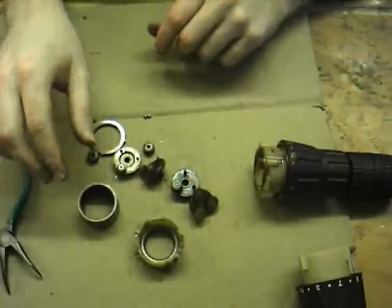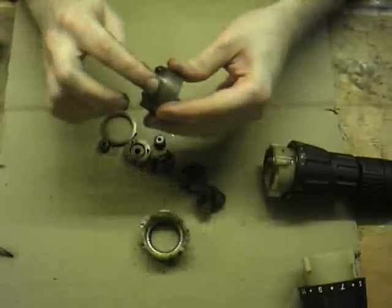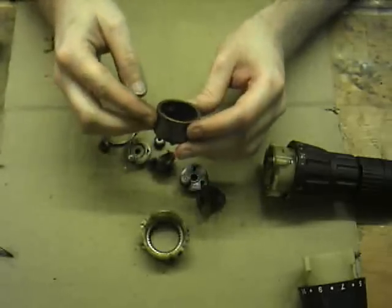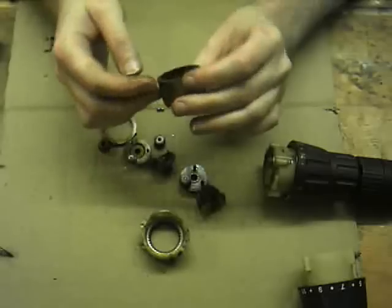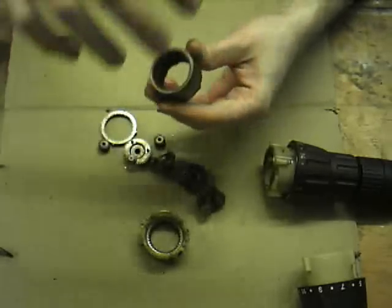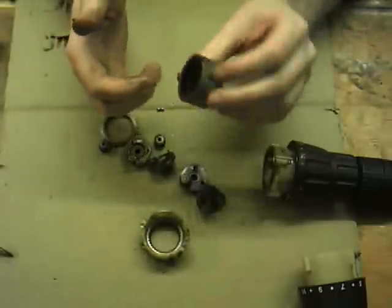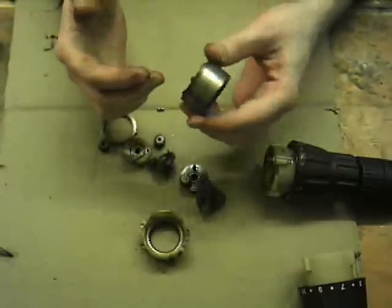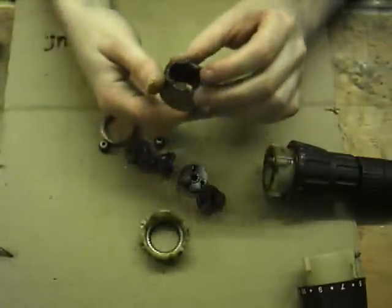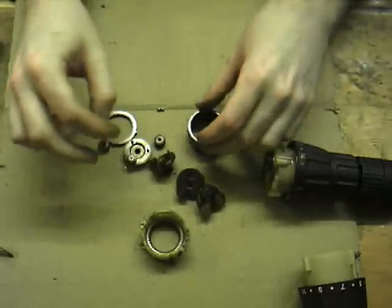Now, what I saw them do on the Pi-1 blog was, because you've got these teeth here, you've got something that you can secure the annular gear to. And what I'm planning to do is, his one was completely encapsulated in an aluminium block with a hole milled out, and this is steel, this is quite nice, it's going to be very sturdy, so all you really need, I think, is to make a recess in a plate. I'm going to go for making a recess in a plate with some holes to accommodate the studs here that will stop it from turning in the plate.